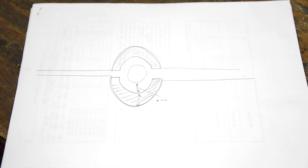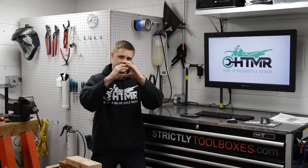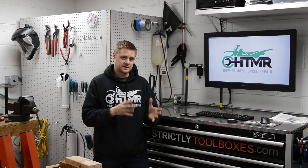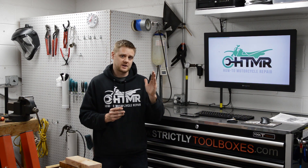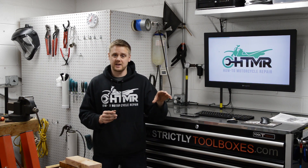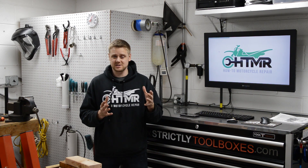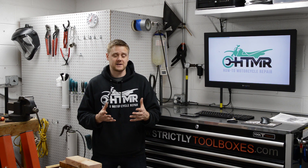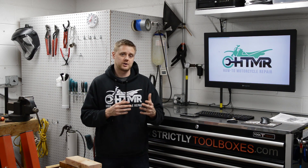Find that question mark. Step one is to locate the stamp marks on the engine case. What those stamping marks mean is there's either an A, B, or C, and that gives the bore size a certain tolerance range. This is stamped at the factory — they'll machine both cases together and whatever tolerance range it fits in, it'll either get an A, B, or C for each journal. On the casing there are five stamp marks for each journal. I usually run with these numbers because the case doesn't really change or wear over time.